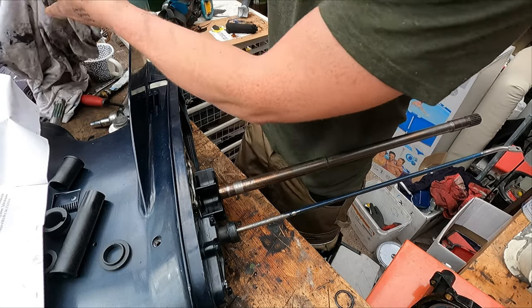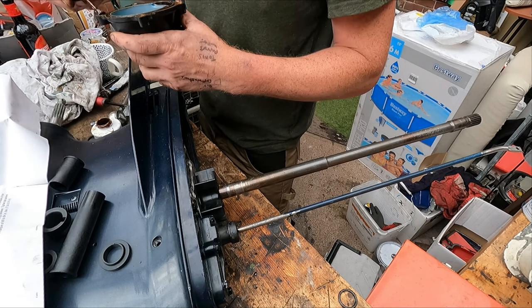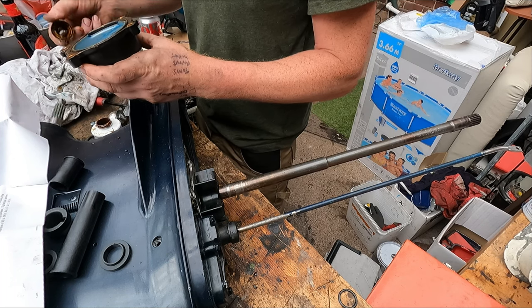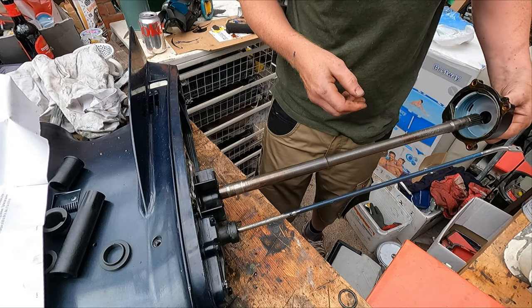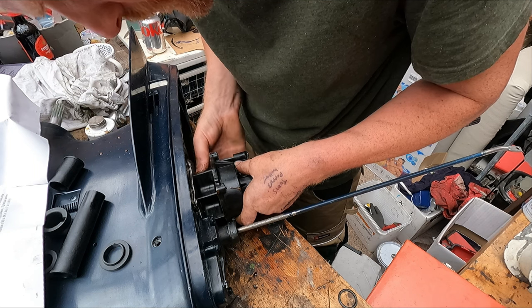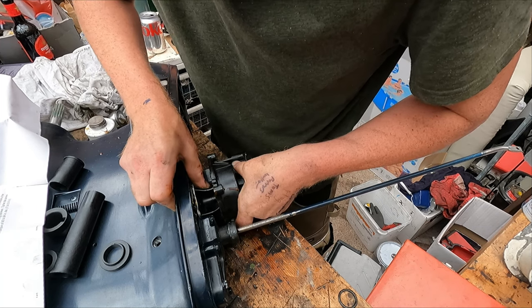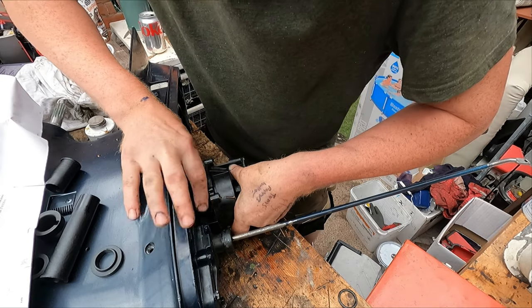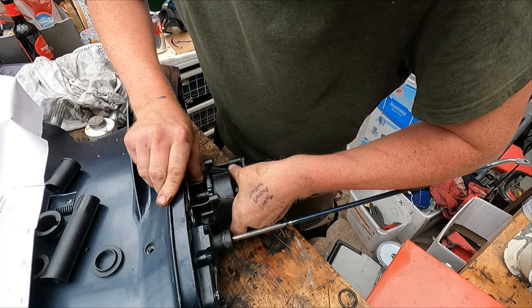That's it. So it just wiggles into position. So, gasket sealing compound on those. Goes that way. So this should be anti-clockwise. So you just rotate the impeller a little bit as you're pressing down on the housing, and if you get it right, it should just pop in. But rotate it anti-clockwise, so facing the engine, or facing the back of the engine, put the impeller in anti-clockwise.